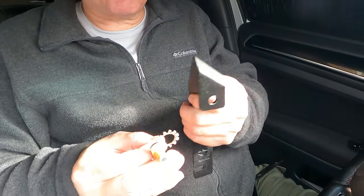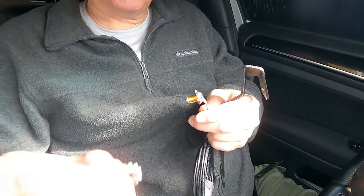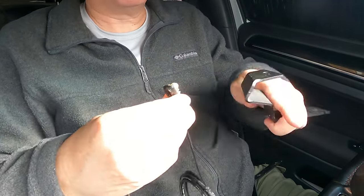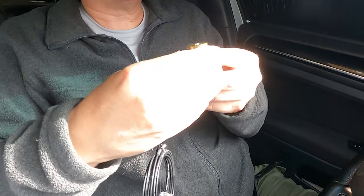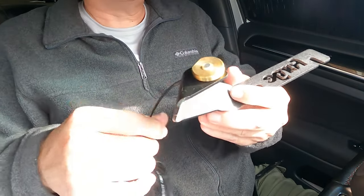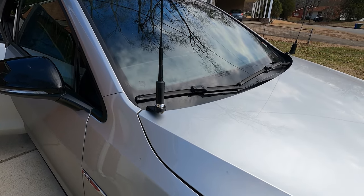But this is less than a square inch — I can get it on there, but it'll also hang off once it's centered over the hole. So what I have instead is some three-eighths inch star washers. I'm going to throw the three-eighths inch star washer on there, add the NMO, and then put on the outer sleeve. What I will probably do is route it like this, then tighten that down with a crescent wrench and route the cable to inside the car. That'll give me a pretty clean mount.